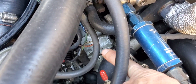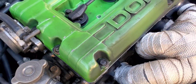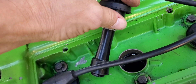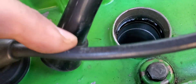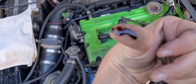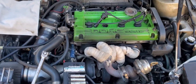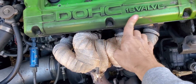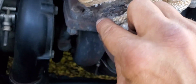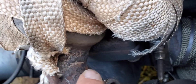You can see all the oil down there — it pools up under here too. One of these seals is starting to go; you can see that oil right there. We're going to do the valve cover. Should be pretty straightforward. Also this manifold is just getting cracked — there's a crack there and another one that runs over this way.